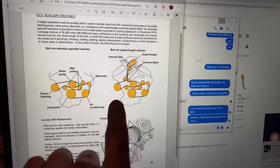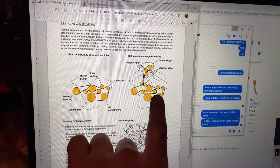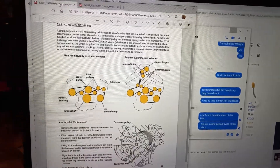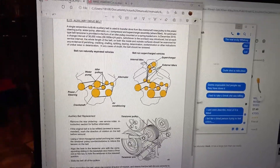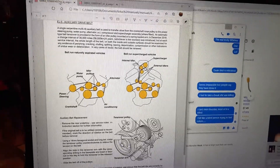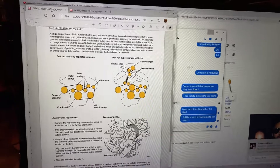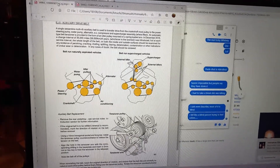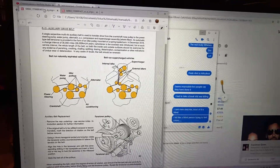I backed up on that and decided to do it on the power steering pulley on your far left — well, looking directly, that view is far left, but underneath the vehicle will be to your far right. So I was going to pull this tensioner pulley with my left hand and then put the belt on with my right. If you have the correct tools, that is the absolute best way. I had the tensioner pulley kit and I could not get to the crow's foot to actually sit on that tensioner bolt — I just couldn't get the right angle. You kind of just need the perfect 14mm length to be able to pull that tensioner pulley with enough brute force. Mine was too short and I had to kind of muscle it. If I had the appropriate tools and the appropriate length 14mm wrench, it would have been a hell of a lot easier.